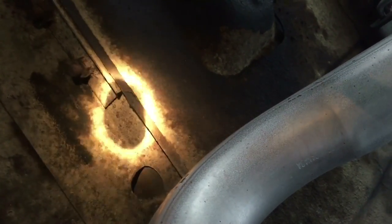A pretty important thing you're going to want to do is crawl under the car. Make sure that when you're going to drill through, you're not going to drill into your gas tank or something. So we're under here now. I'm going to look up there — you can see that's where the current seat belts are located, across on the other side too. We're going to be drilling right next to it, right there.